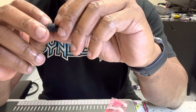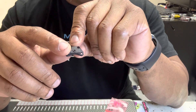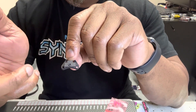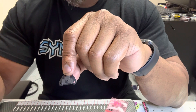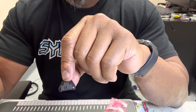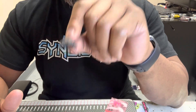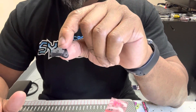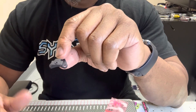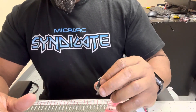When I first originally designed it I did put a hole here for the chassis brace, but obviously if you start sliding it back and forward the chassis brace isn't going to work. I haven't built a car with a chassis brace in probably a year — I don't really think it's necessary. So I would not use a chassis brace if you're going to use the caster block, because if you have it slid back and try to screw the chassis brace in it's going to tweak something.